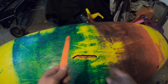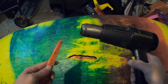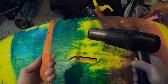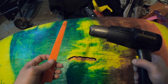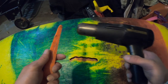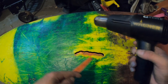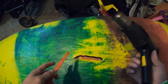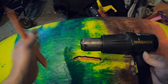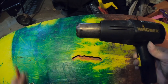We're gonna heat up the crack itself and the stick. I've got my heat gun and this is basically the main tool. You will need a grinder to clean things up and to cut the strips, but you could use a rasp, or cut the plastic with a knife, a handsaw, or whatever. With this method — the heat gun or plastic welding method — we're going to fire this thing up. It takes a while to heat up: for the first couple seconds it's like a hair dryer, and then it starts really cooking. I usually do it on the high setting.